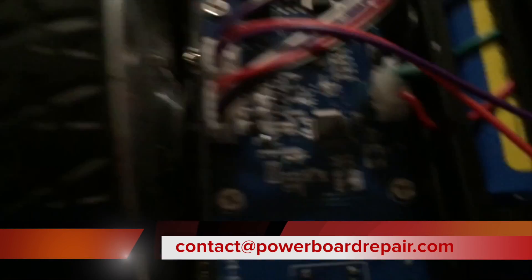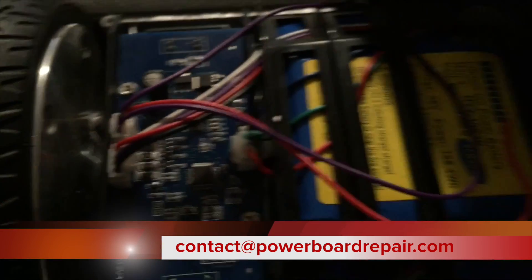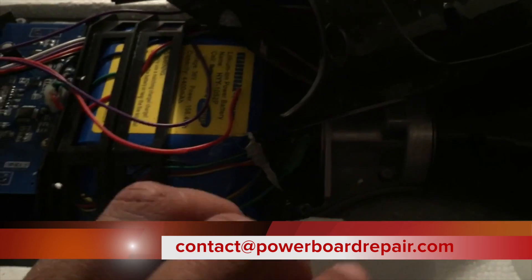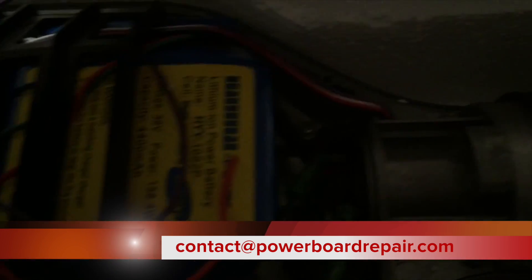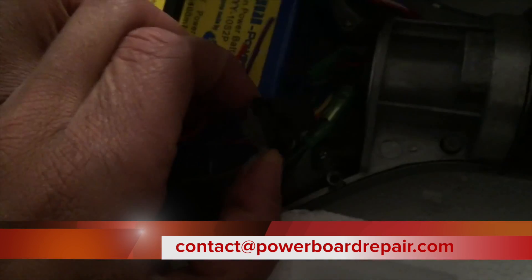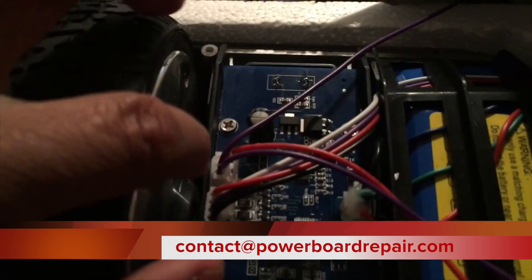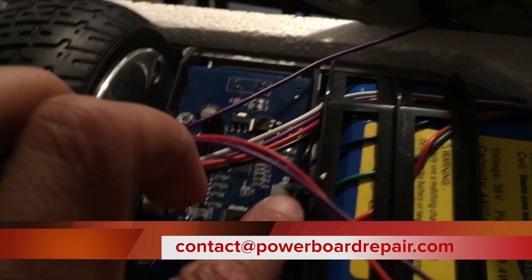You don't want to break those wires. You see those three harnesses right there — there are three harnesses. Those need to be disconnected. But before you even do that, you want to disconnect the power supply from the battery from the hoverboard, because you don't want to damage anything. So that's the rule of thumb — disconnect that cable first. And then from there, you're going to disconnect the three harnesses.